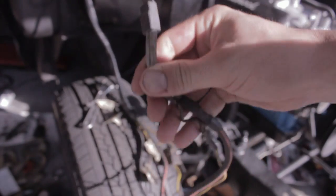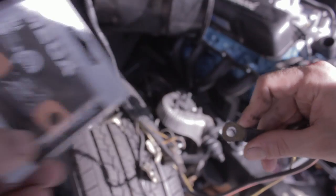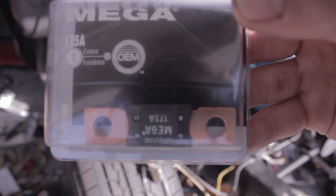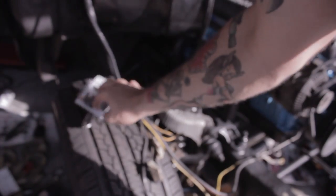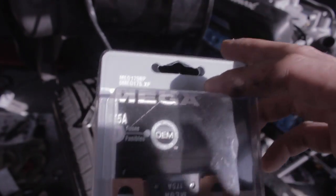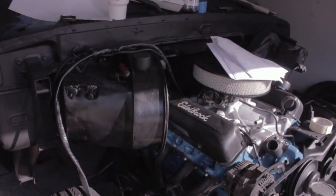The only other thing you need to complete this conversion is a mega fuse. The big lead from the alternator runs all the way to a mega fuse, which you can grab from the junkyard or get at O'Reilly's for five bucks — it's a 175 amp mega fuse and you have to have that to do this conversion. So the alternator was about $25, the fuse was five bucks, and then some soldering and tape. About 30 bucks total and you do the upgrade and you have a 3G 130 amp alternator set up, and you can run an electric fan, air conditioning, a big loud stereo system, or whatever your heart desires.